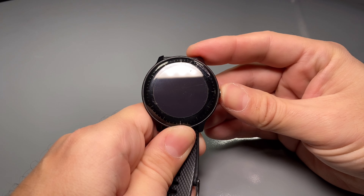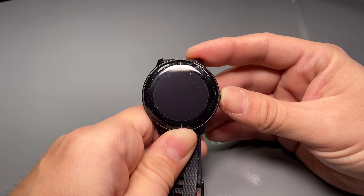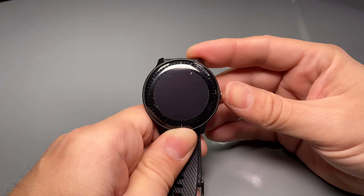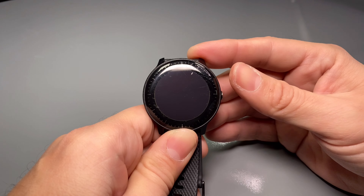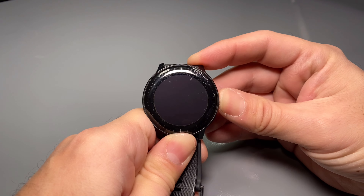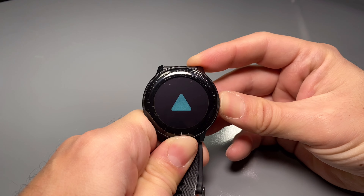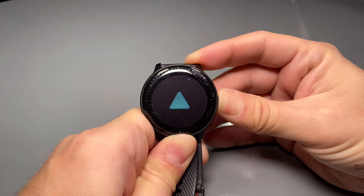The screen is black. Now we're going to press and hold the button for about three seconds and then let go. Then we're going to press and hold the button again continuously until it vibrates three times — two vibrations, wait a moment, then a third vibration — then release the button. So here we go: press and hold, one, two, three, release, and press and hold again, waiting for the vibrations.